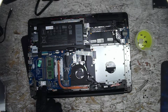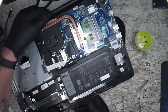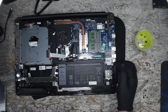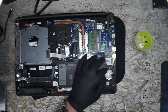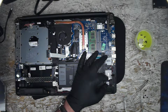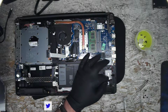You've got an M.2 wireless card. Not bad. It looks like you can also throw an M.2 SSD in there, judging by the label, in case anybody can't read that upside down. We'll spin it around. It does say SSD, and you have room, it would appear, to run out. If you're going to use anything other than, I think, the 2280 length, which is the common length for most of your M.2 drives, you can get them in different lengths. You're going to need an adapter to run out.